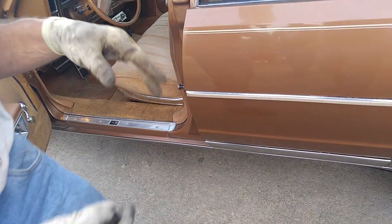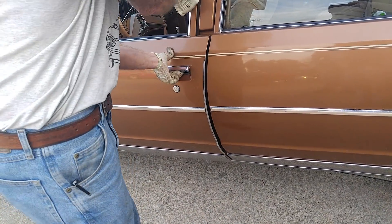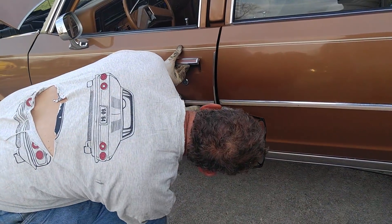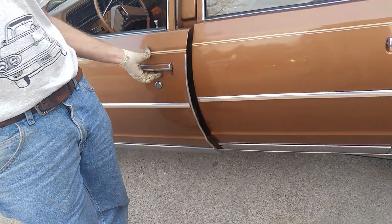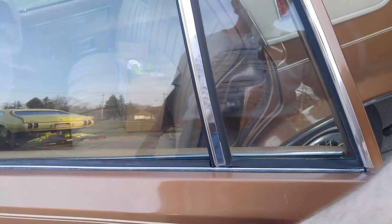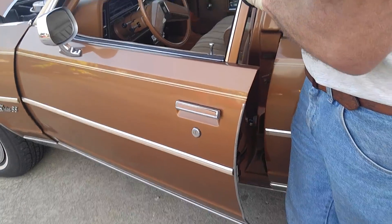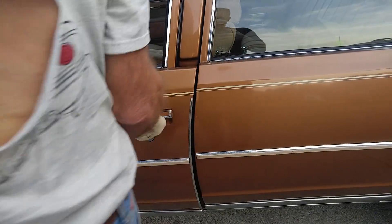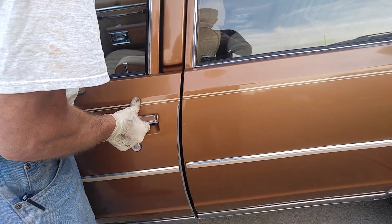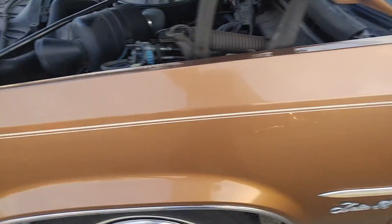That's it, and now it's tight because it's low mileage. That's what it needed, but it's tight. That one's missing too — they all are, they fell off. Are you sure there's supposed to be something there? One hundred percent, oh yeah, watch my videos. But why is it closing so tight? It actually tends to sag a little bit. It's too tight — that's what's binding here. It is missing the bushing. Let's go look at the other ones. One hundred percent, it's missing the bushing.